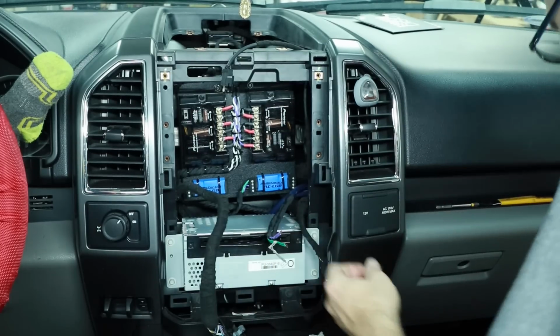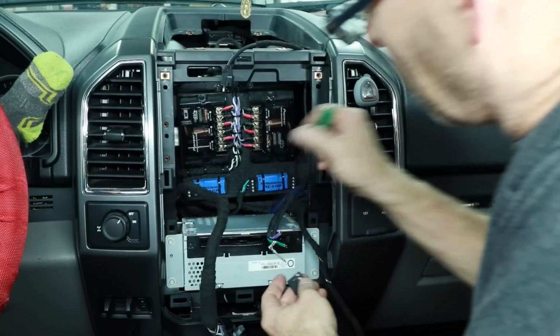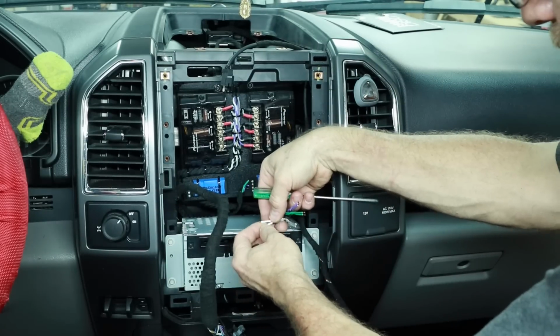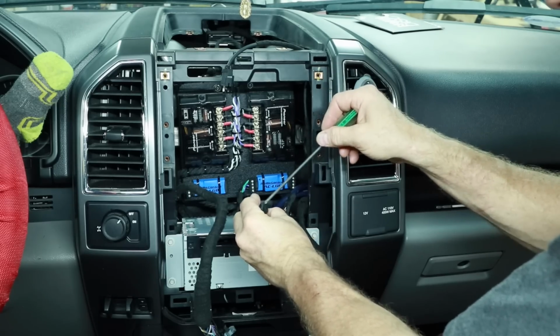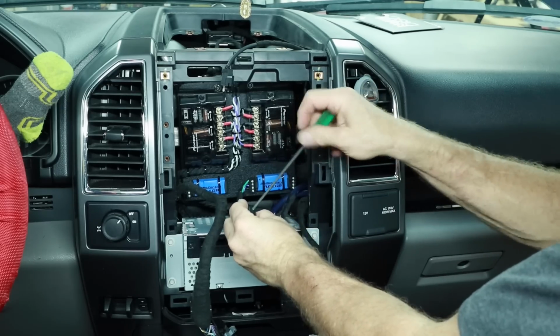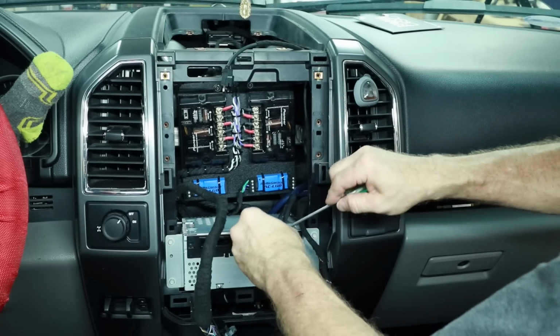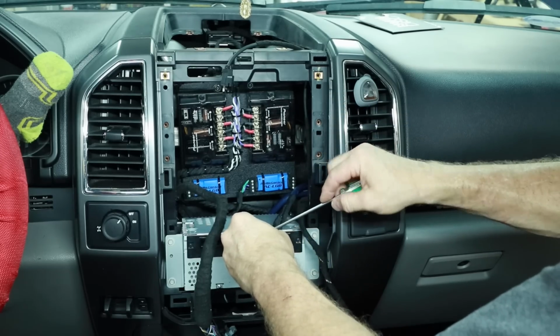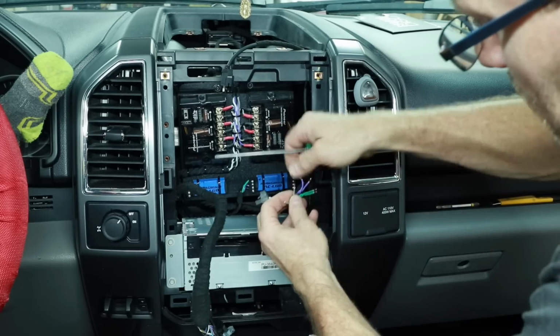We just need to make sure that when we're putting these in, we get the polarity in the right direction. On this one, it starts with white on the top, and then goes to white black. Polarity is extremely important as you're doing these systems where you have multiple connections all throughout the car. Keeping track of that is becoming more and more difficult. We always do a polarity check when we're done wiring up a car because of that.